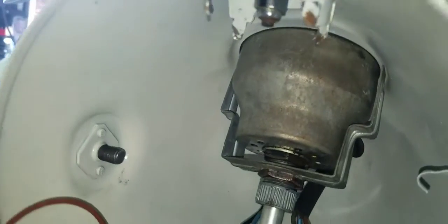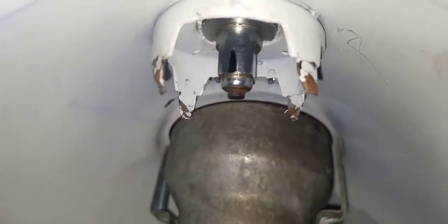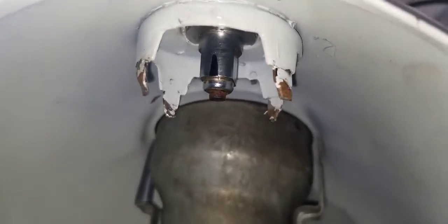And like that. Okay. Now, part of the reason why we're having problems getting power with your bike is because your key switch is completely worn out. Short story, we need to replace it. And we're going to have to find a replacement somewhere, but this one's worn out. Here's what I'm seeing with your key switch.